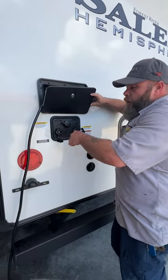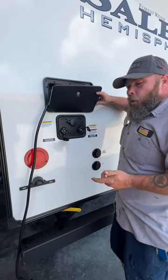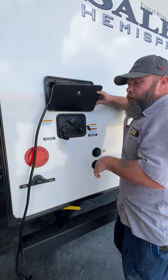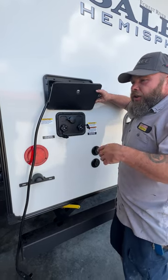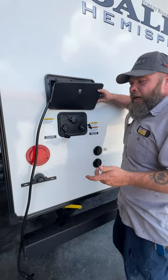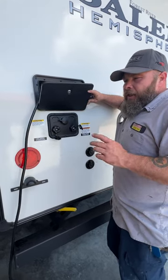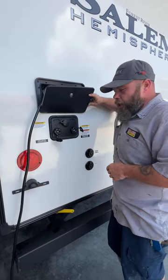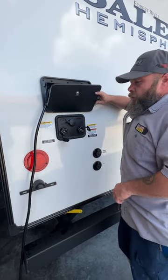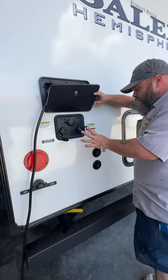Next, we're going to have the city water hookup. You always want to use a pressure regulator at the water spigot. From there, your option is an in-line water filter and then your blue or white water drinking hose — hook up to here. You'll be ready to use the cold side right away, but you do have to wait for the water heater to fill up before you'd have water coming out of the hot side, and then you would have to turn it on to get your hot water. It does have gas or electric options. Then this guy here is going to be so you can fill the fresh water tank. I always do recommend using a check valve with this style system setup.